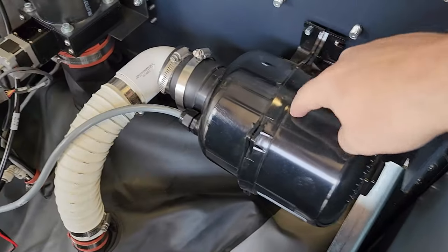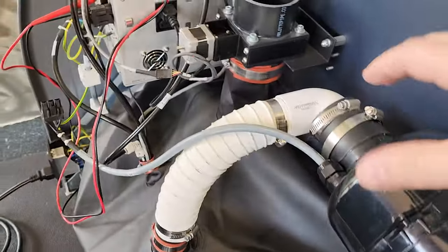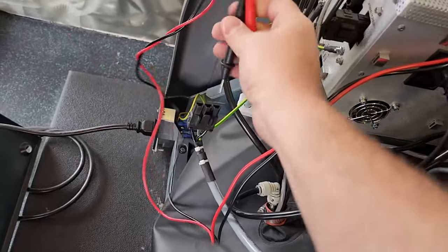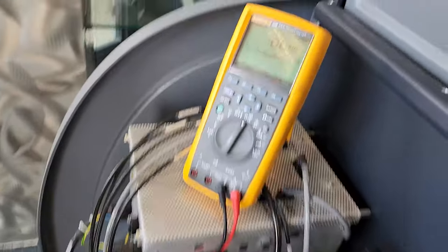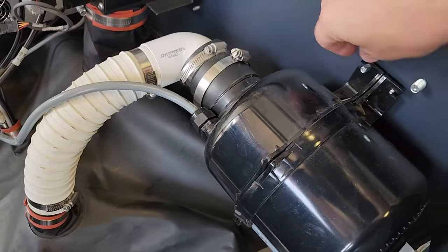You can see we have 200-and-some volts at the port. This is just a standard blower you'd see in a sauna or spa — about a $130–$140 part. Let's pull these out and turn my meter over to ohms, because being a motor we should be able to see ohms. But I do not — that means there's a problem in the motor.